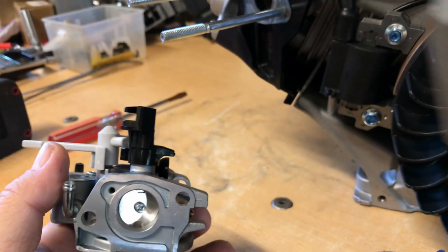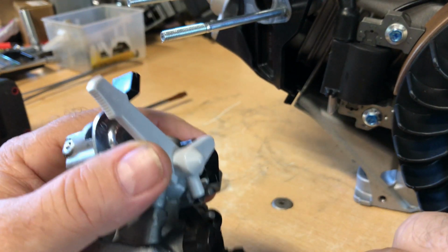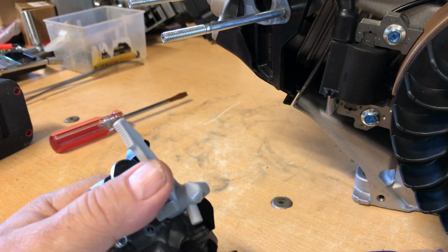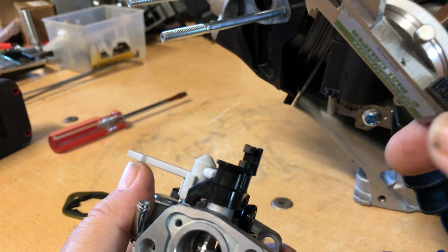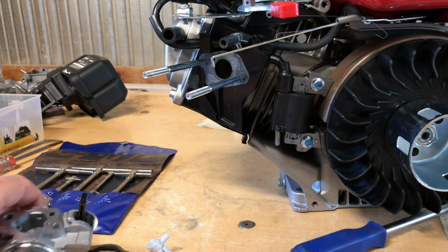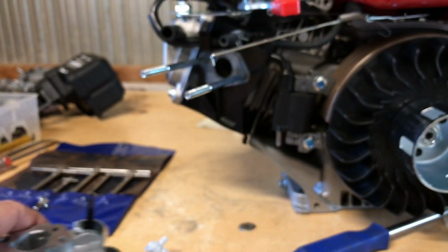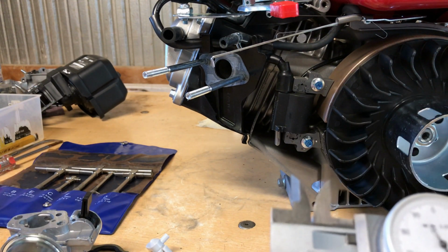And now that's not the venturi. I'm going to get another measurement on the venturi. And since I got those nifty, handy dandy long reach bore gauges now, I'll go ahead and pull the choke butterfly out of this thing and get a measurement inside, in there, to where you could see the venturi of the carburetor, which is quite a bit smaller than the bore, quite a bit.